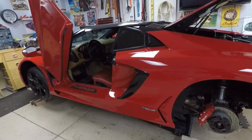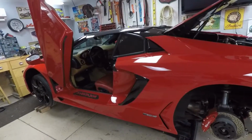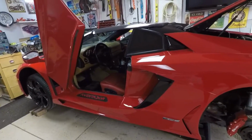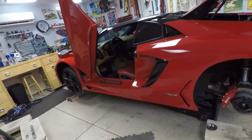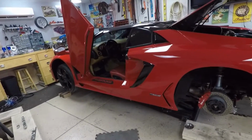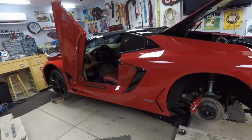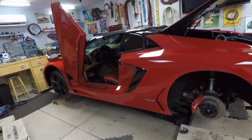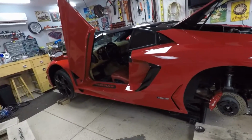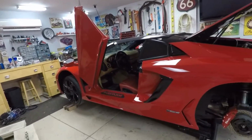It was that little thing, that little wire is so basic and generic you wouldn't think it does anything, but it definitely fixed my problem when I replaced it. So that's the first thing, no matter what everybody on the internet says, the first thing I would do is take the gas cap off, push that little flap in, and listen for that clicking noise. Every time you push that flapper open, I think it's like 90%, just push it all the way open with your finger, you should hear that little solenoid click.